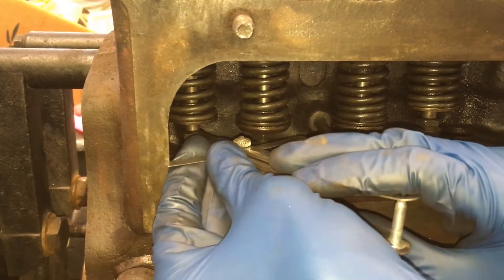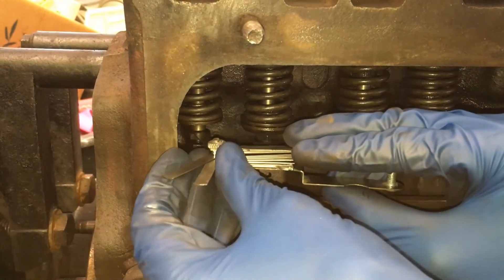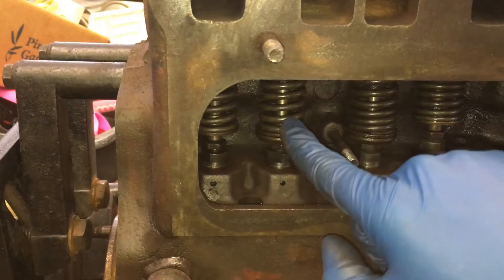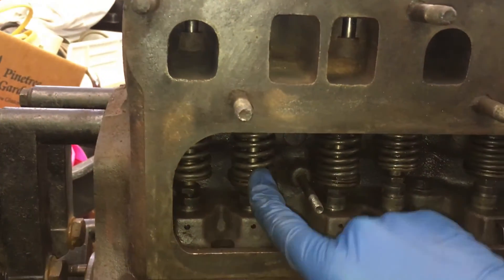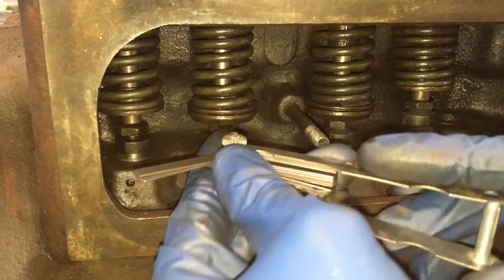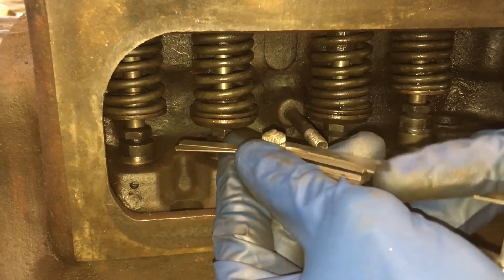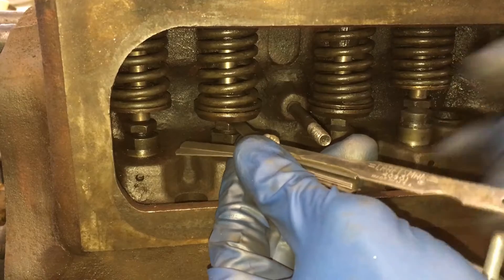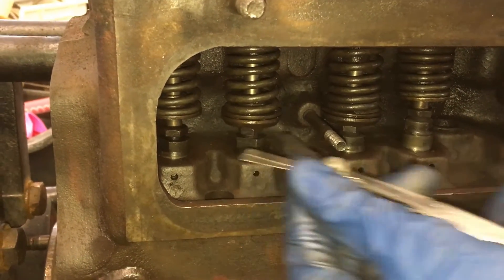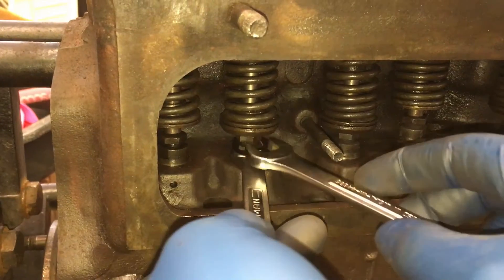Me pushing on that, it goes down a little bit but it's really, really tight. So 18 has just a little bit of resistance and it feels really good. Now when I go to measure the exhaust side, it's a little bit different — you can't really see it as much, but if you put it at the top you can feel for it. It's really, really tight and I can't get it in there at all with the 18 thou. So I'll have Andy go ahead and loosen that up a little bit to bring the gap a little bit bigger.